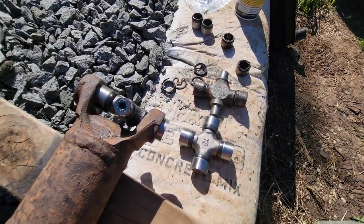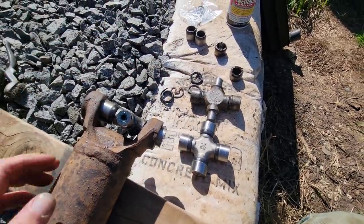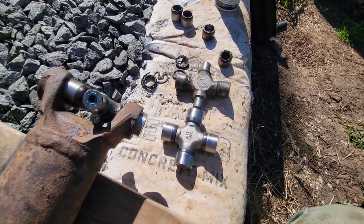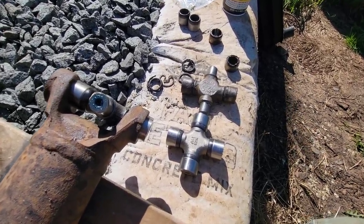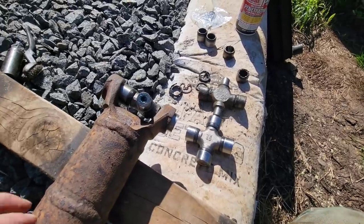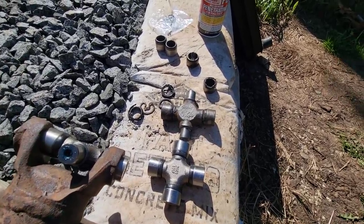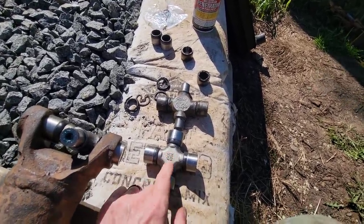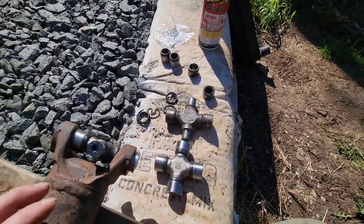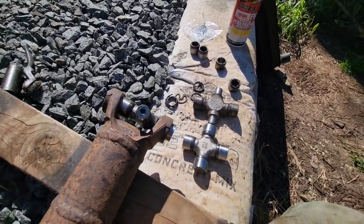Well, I just got off the phone with Chuck from Chuck's Trucks, LLC. And after I send him a few photos of what we're dealing with here, he's determined that not only do we have the much larger transmission than we thought, that it's more than likely the more rare but nicer 5-speed synchro NP style transmission, which apparently they've also used the drive lines and adapted the bigger yoke to the stock rear end of this 48 bus. The stock 48 bus would have taken these smaller yokes, but it's taken the larger one, so they've adapted a larger yoke to that stock rear end and used the transmission and drive lines from a bigger truck in here.